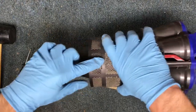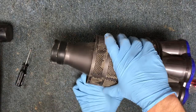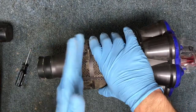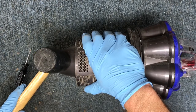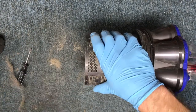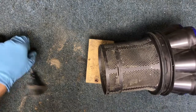Next it requires a little bit of brute force to get this piece out. It's held in place with little tabs. The most effective way is propping the part up on a little block so it's cantilevered over, then take a rubber mallet and strike it firmly and it pops right out. I've never had one break doing that. You can see how nasty these are — this is a pet vacuum, obviously you get pretty nasty buildup.